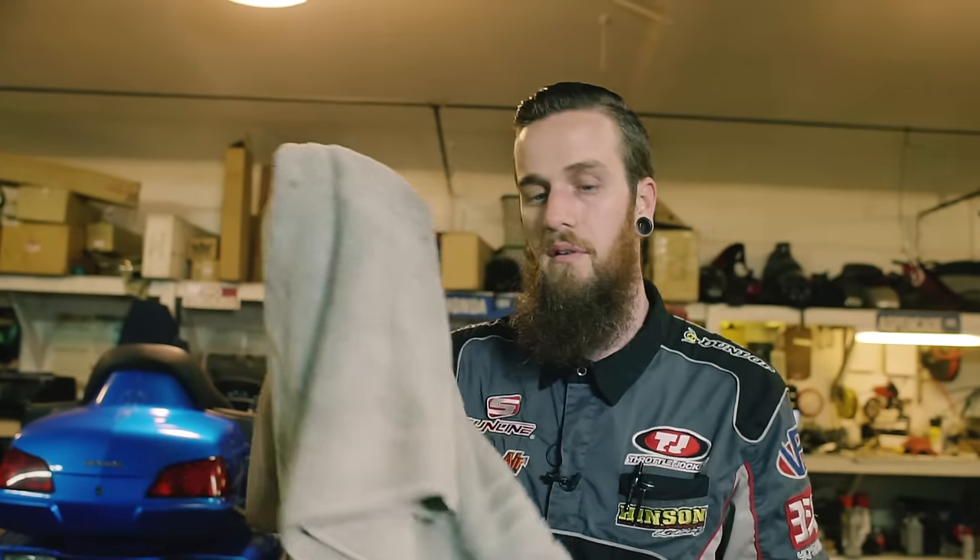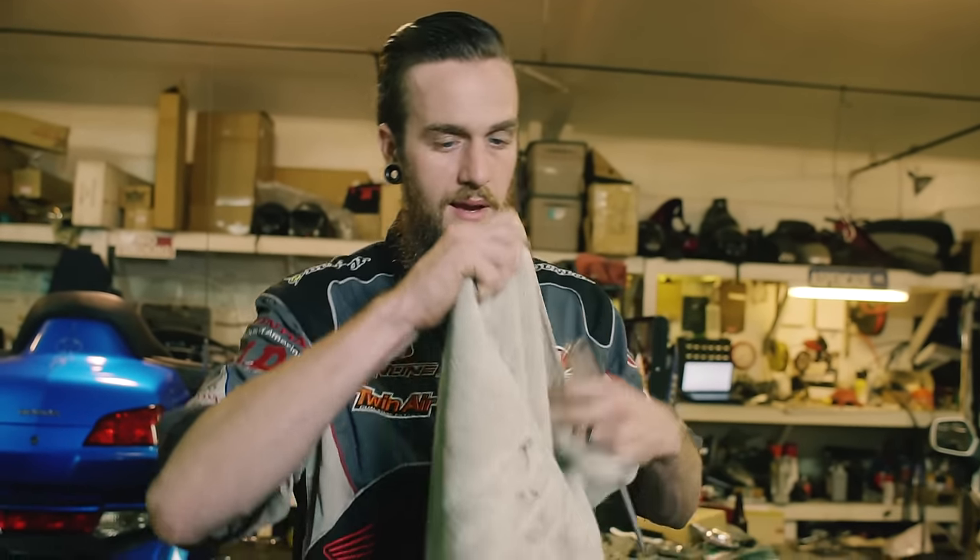I like to get some paper towels ready as well. If you have a nice paint job on your tank, go ahead and grab a towel and throw it over the tank. Brake fluid is extremely, extremely corrosive and it will wipe the paint just like that. I promise you it will ruin anything that it touches.